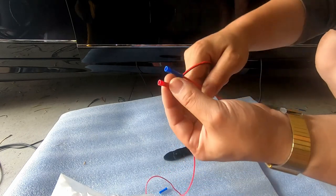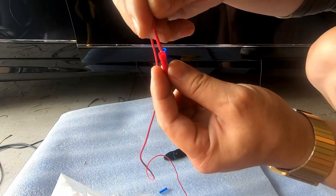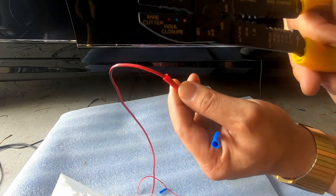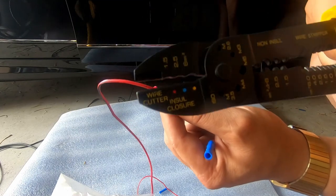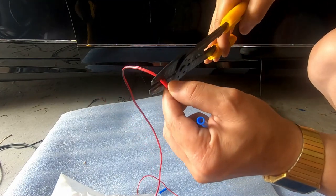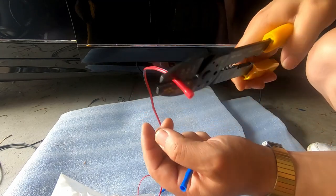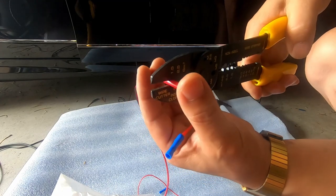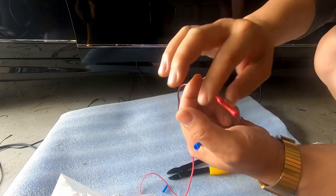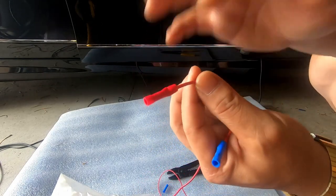Say this was your fuse tap on the end. Just put your wire in — this is the easiest way to extend your wire. It is a red connection so I'm going to go with the red colour. Put it in and get it in the red area. Make sure the wire is in there and then just crimp down. And there you have it — a secure connection. That's how easy it is to connect to a fuse tap.